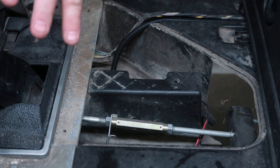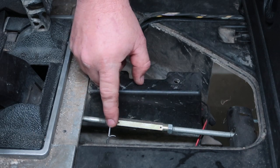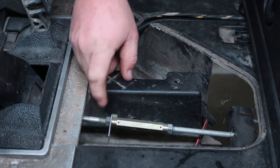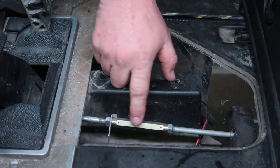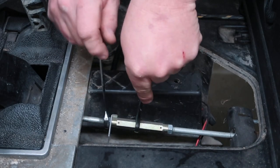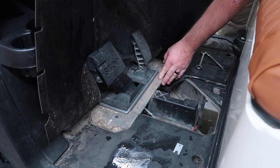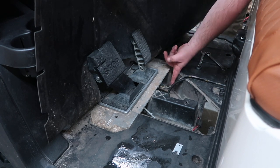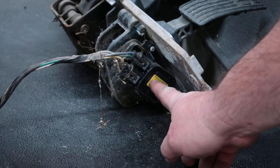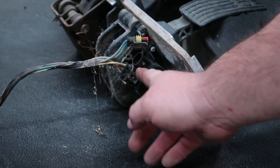Now before we go ahead and remove the pedal group away from the golf cart, we need to disconnect the brake pedal from the brake rod itself. Also, remember if you have a light kit, you need to go ahead and disconnect that as well. I'm just going to take this spring here and pull it out the back — now that is disconnected. Now you need to grab two wrenches: one to hold your connector together and one to hold the nut. This is going to take a half inch wrench. Once you have the brake pedal disconnected from the brake rod, you can go ahead and remove the pedal group. Just note the M-core wiring on the accelerator pedal is still hooked up, and once we get it up we need to disconnect those wires.